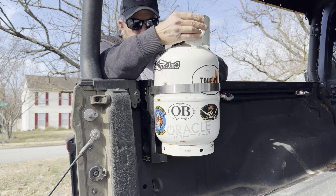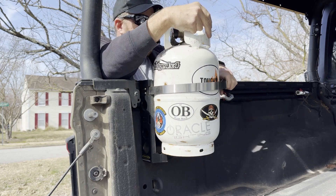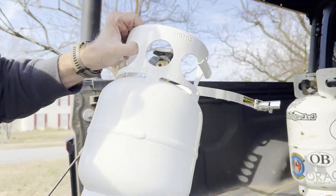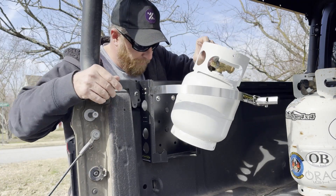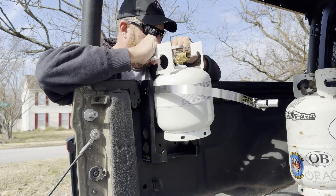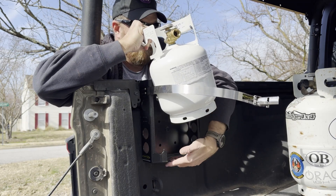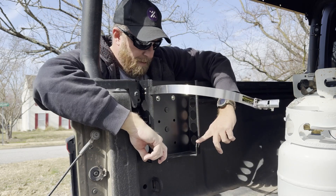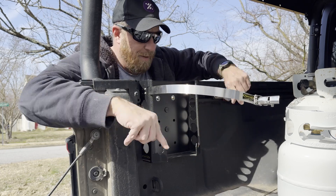It fits like a glove, but I don't really need a 10 pound tank so I'm downgrading to the five pound size. Save a little weight, save a little bit of space, not quite as high of a profile. The downside is the feet on the power tank mount don't fit the rim of the propane bottle. The rim on the bottom of the five pound tank is just a little bit smaller, and I'm going to change over the feet on the power tank mount to be able to accommodate that.